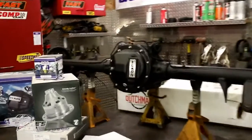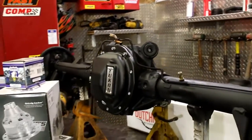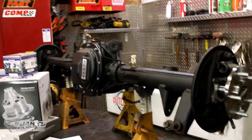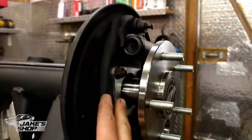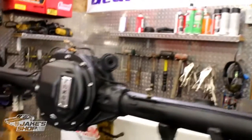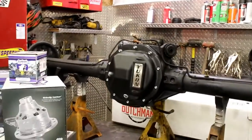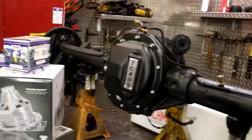Okay, so what we've got here is a GM 10 bolt axle. Most GM axles are going to be very similar — there's going to be a lot of things that are similar throughout this video. The big difference on this one is it's a non-c-clip style axle. You're going to notice that by this big plate in here. Your bearings are actually held in and the entire axle is held in with this plate. When you open the differential up, you'll see that there's actually c-clips on a c-clip style axle, so they're slightly different.